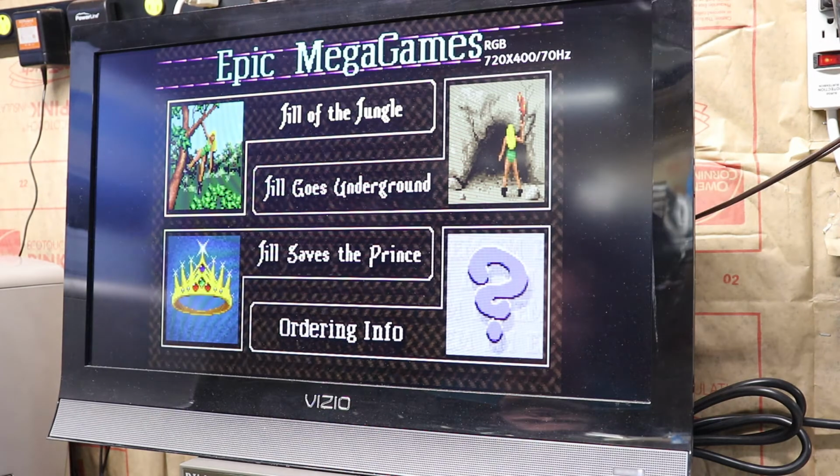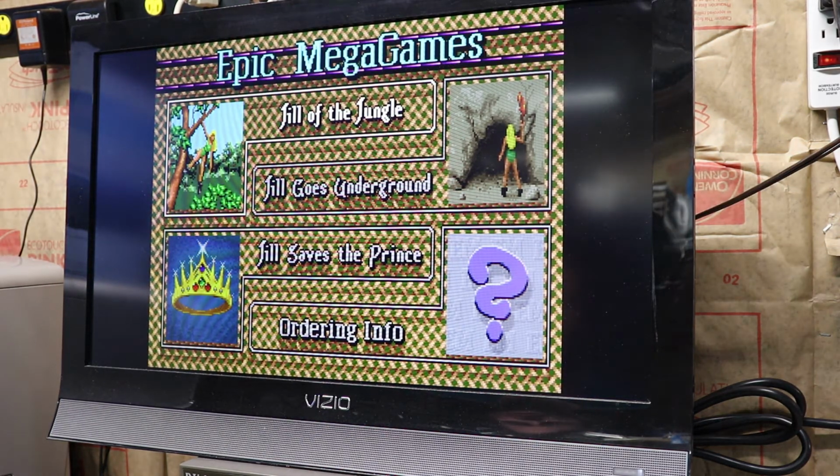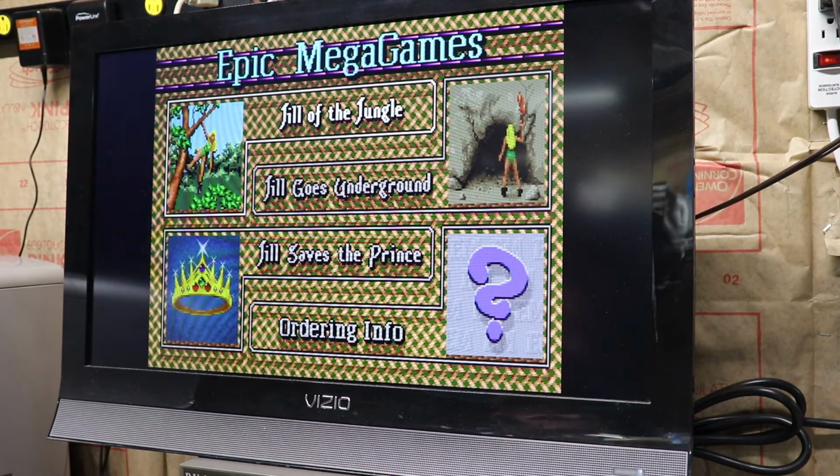So like I said, you can hear a little bit of stumbling in there. It's going to happen. I probably also got some decreased speeds from the XT card being transferred back and forth, which is limiting it a little bit. You've got to remember that XT IDE card is running at 8-bit versus 16-bit. There's going to be some slowdown there. It's to be expected. But did I save the 386? Yes, I did.